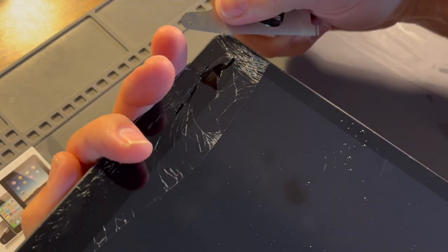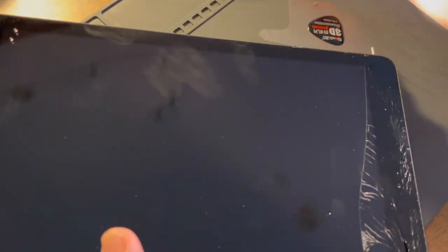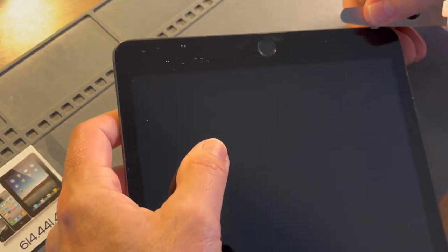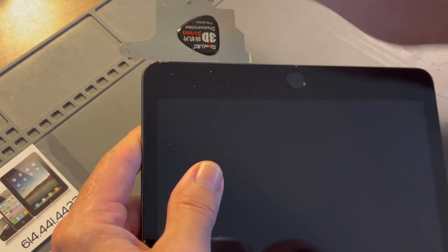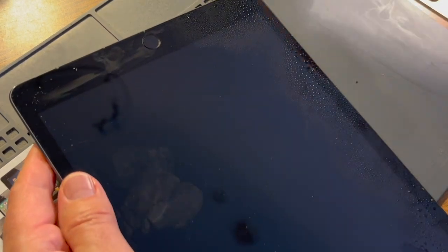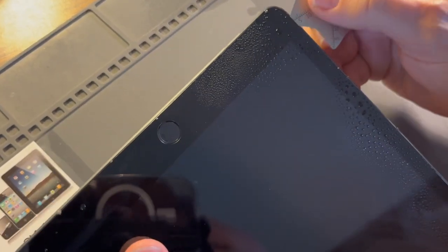I'm going to hit both these edges real quick. This side already dried up because of the warmth. Sometimes I spray and just work it with the tool, but it's cutting through pretty well on this one today. Right here I take extra care because I know there's a control chip and the cable runs right through here — so I don't want to go very deep around that area. Usually once I get that first tool in to break down the adhesive, I'll move on to this tool, which I use for the majority of the separating process.